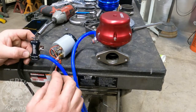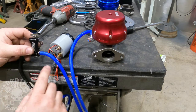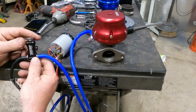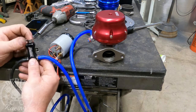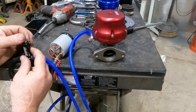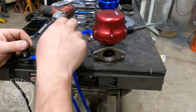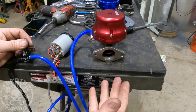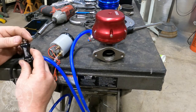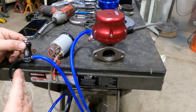Let me explain this a little better. You can see this is open right now because I have this down all the way — meaning I have 10 PSI going through this whole system because this is closed, so all the pressure is going through. All this wastegate controller does is bleed off pressure. So we'll still have 10 coming in but it'll bleed off pressure, simulating that we have bigger springs in our wastegate. We closed it, and because of our testing earlier we know this valve opens at around 4 PSI. That puts us below the range number we need to hit. And we know with this boost controller I can turn it up beyond 10 PSI, which is higher than I need to go. So this should get us within range on our turbo system.